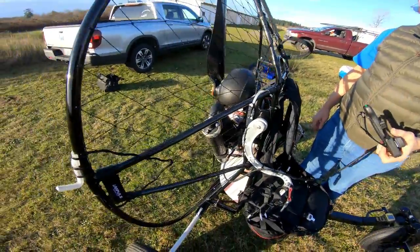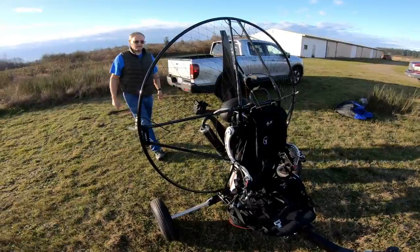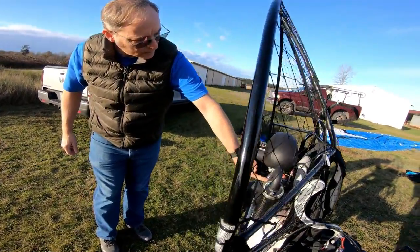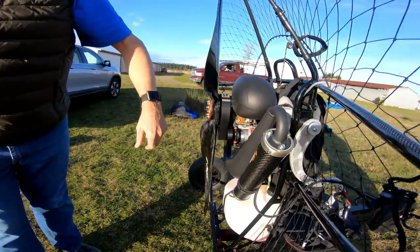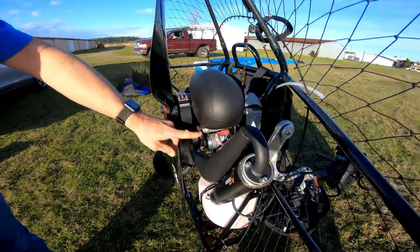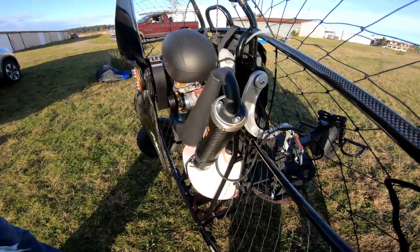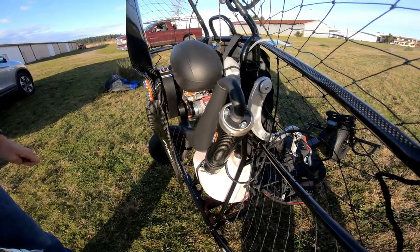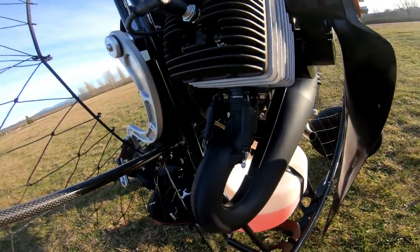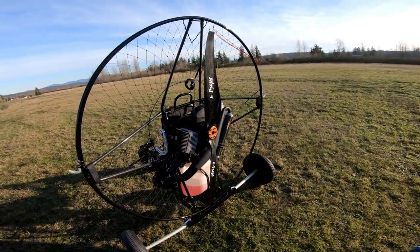And he's got the Mighty Moster 185 on it. But this is a new MY19 Moster. Really slick unit here. Motor for the starter. And the new MY19 has a different airbox, different carburetor, and the internals of the exhaust system is different. All right. So it's supposed to be more fuel efficient. There's three springs instead of two, I believe. All right. So you get one, two, and three. Awesome. A little bigger gas tank than my Maverick had.